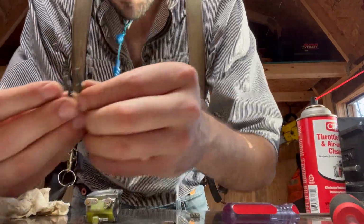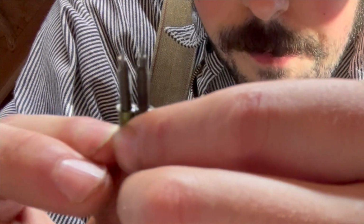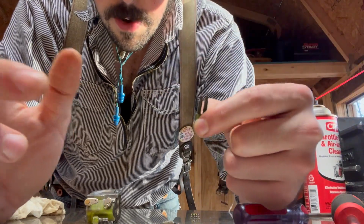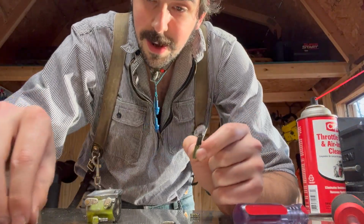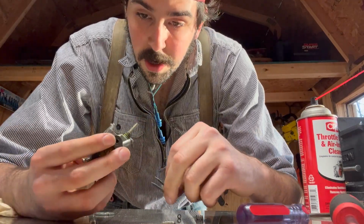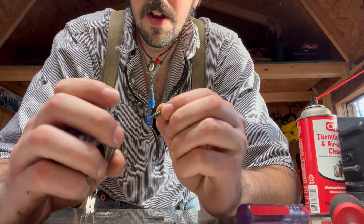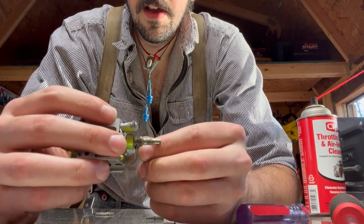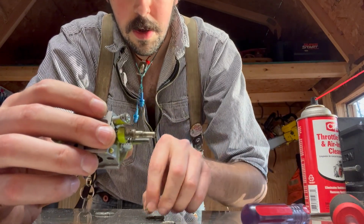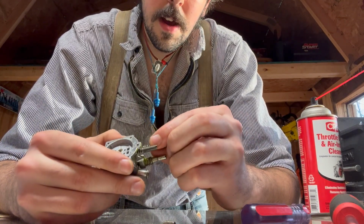Now these high and lows, I just want to show you guys again, these are identical. I mean, completely identical. They're out of focus, so you guys can't see them, but I can't find any differences. So we'll just say they go in exactly the same. Put your spring on and screw it in. These are super fine little threads, I'll tell you that. Spring on and high screw.